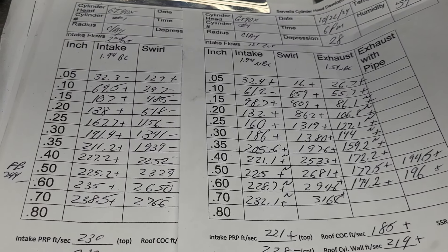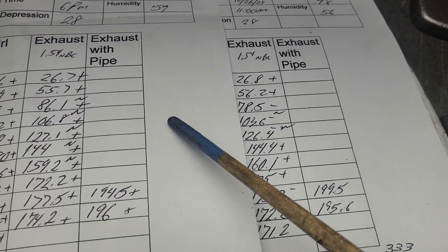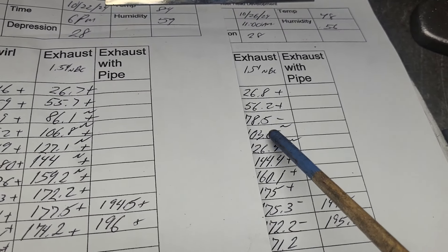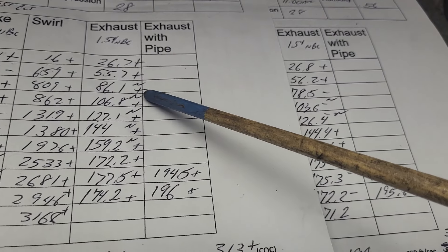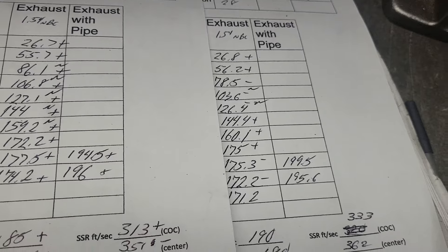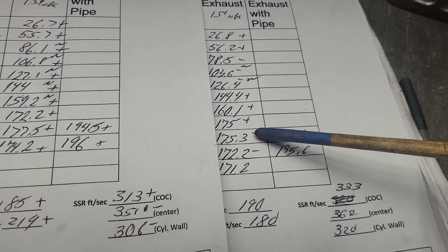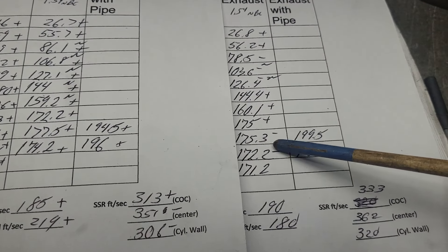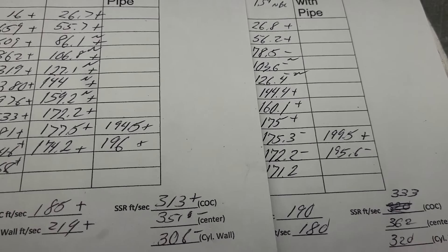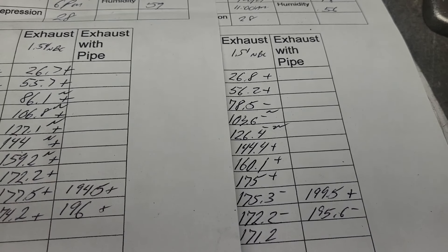Exhaust second cut versus first cut — not a huge win. If I have some gains they're very small; if I have some losses, some of those losses are pretty big, like 86 to 78, which isn't good. We had four or five points of noise and I got it down two spots — as far as I'm concerned that's a win. Plus, plus, minus, minus, minus, plus, plus, plus — this is an important area right here. We don't quite top out as well, but we don't lose a lot. Looking through the pipe, this one is up and this one is down. Not a complete win, but we really need to look at the air speeds to determine if it's truly a win.